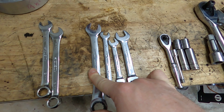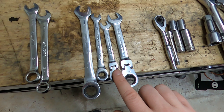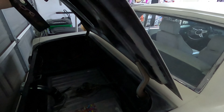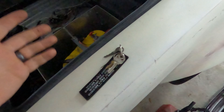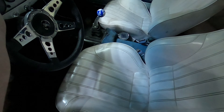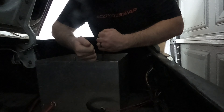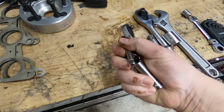Let's go over the tool list - wrench sizing and things like that I'll need for my car to take these headers off. It's concerning that I even know this offhand because I've done this too many times. First order of business: we're going to remove the battery stud, that takes two 13-millimeter wrenches. Next is the starter - we'll need a 10-millimeter and 13-millimeter.